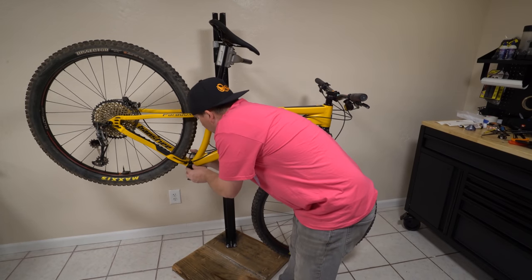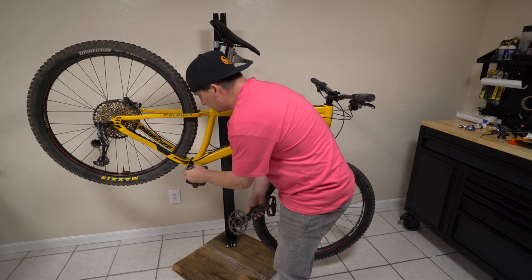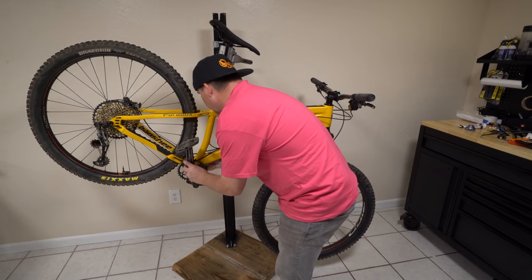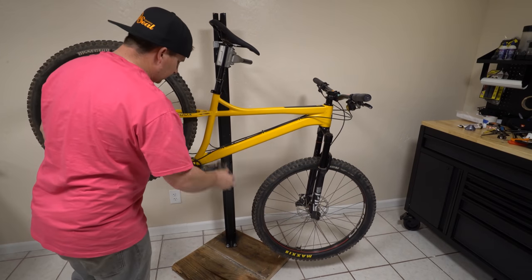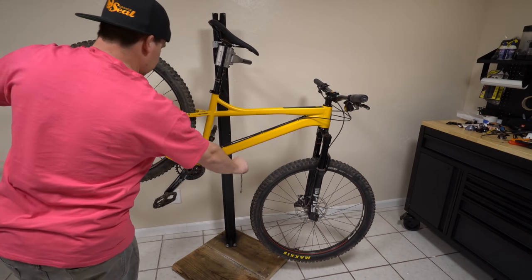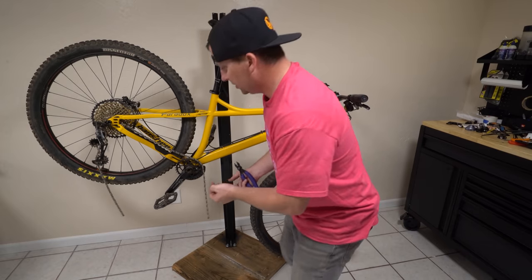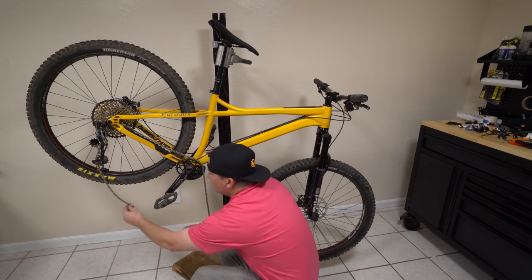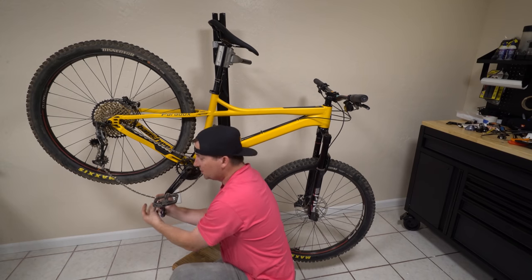We're running Race Face Turbine cranks on here because they're cheap, strong, and reliable. With these bottom brackets, instead of spacers between your frame, you put the spacers between your crank arm and the bottom bracket to get the play just right. That's clearing a 32-tooth Absolute Black chainring — there's more clearance here than there was on my middle child. Chain time — I'm running an Absolute Black oval. This is the first time for my chain: I'm using molten speed wax. You put your chain in a crock pot with hot wax and soak it, so you don't have to wax your chain quite so much. Theoretically. I'm experimenting with it — I'll let you know what I think about it over time.